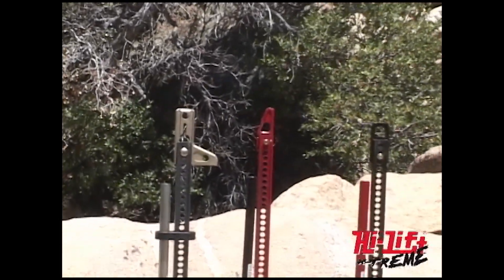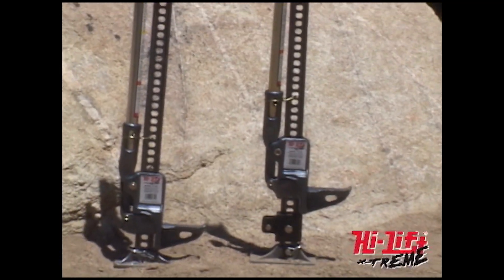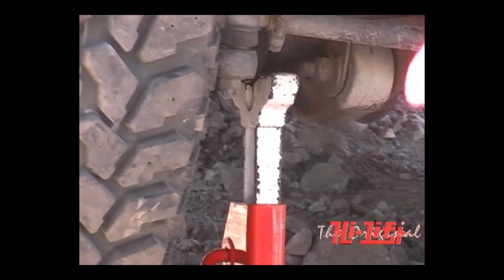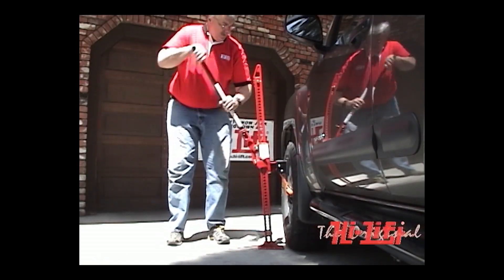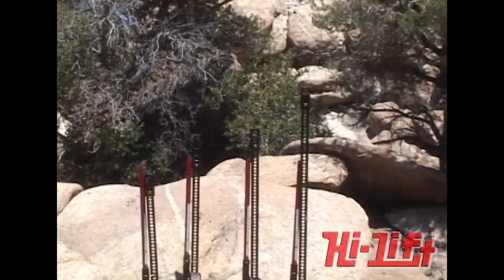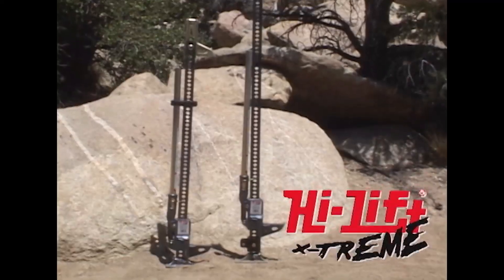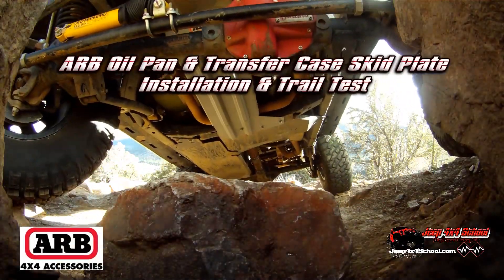Another item that we've always carried — and fortunately we haven't had to use it very much, but when you need it, it's really important — is a high-lift jack. There are several models and lots of attachments, so shop around. The one attachment we really like is the Wheel Mate, which hooks onto the snout of the high-lift jack and has plastic-coated hooks that go onto the spokes of a wheel rim. You can quickly lift a wheel off the ground to do some road building, or if you carry a jack stand, it's a quick way to jack the vehicle up, put a jack stand under the axle, and change a flat tire safely.